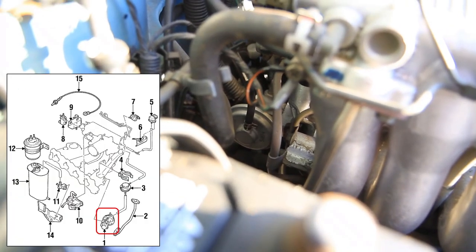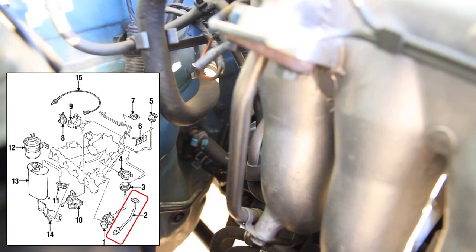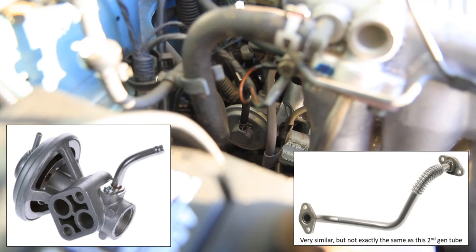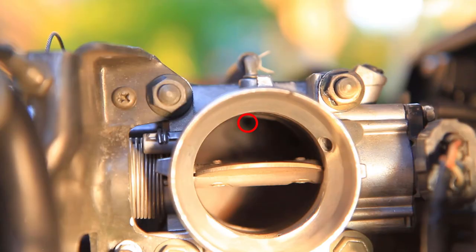The next code I ran into was P0400, indicating issues with exhaust gas recirculation. The external components of the EGR system on the Sidekick consist of the EGR valve located on the back of the intake manifold, a vacuum modulator, and a vacuum solenoid both located on the firewall, as well as a stainless steel tube running from the EGR valve up to the throttle body. I removed the EGR valve and that tube, checked valve functionality by applying vacuum to the control port, and confirmed it was opening and closing as expected. I cleaned both with carb cleaner and didn't find any major blockages. It turned out there was a port right behind the throttle plate — highlighted in the image — that was blocked. I cleaned it with carb cleaner, a small screwdriver, and a thin steel cable to scrape away the carbon debris. Since doing that, I haven't seen the P0400 code in the last two years.